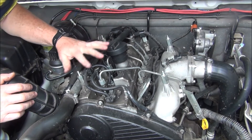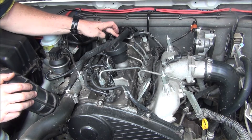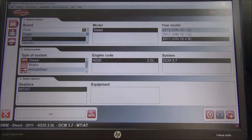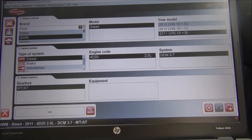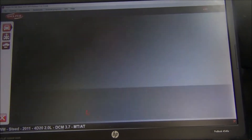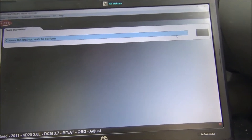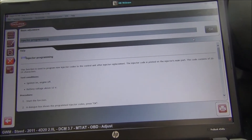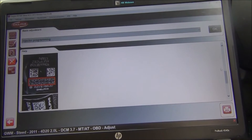Okay, we'll put all the engine back together. I won't put the top cover on yet — we're going to re-enter the new codes for the injector. Every time you replace an injector you've got to put the new code in. We'll go and do that, start the engine, and come back to check for leaks before I put the top cover back on. We're just going to program the new injector into the ECU — I've got it all plugged into the OBD2 port and I'll fire up the software.